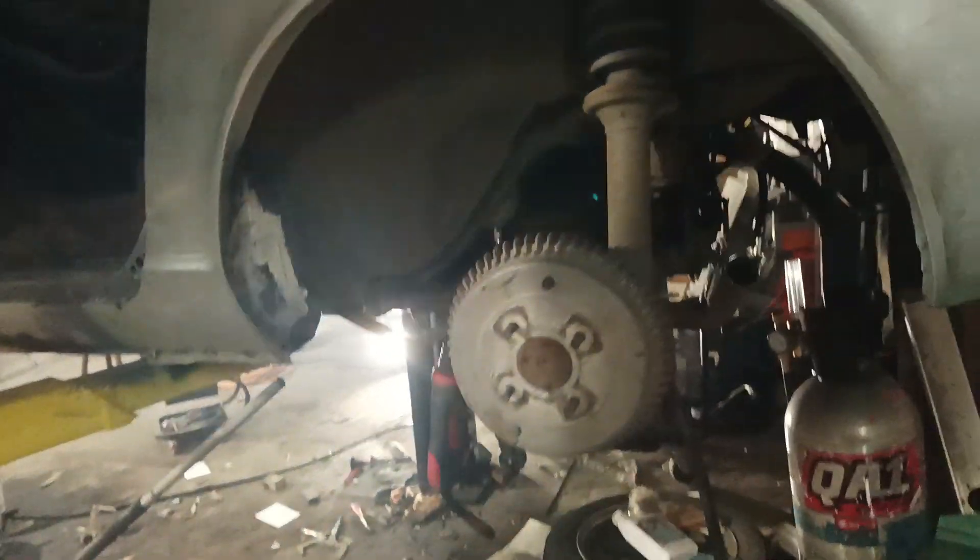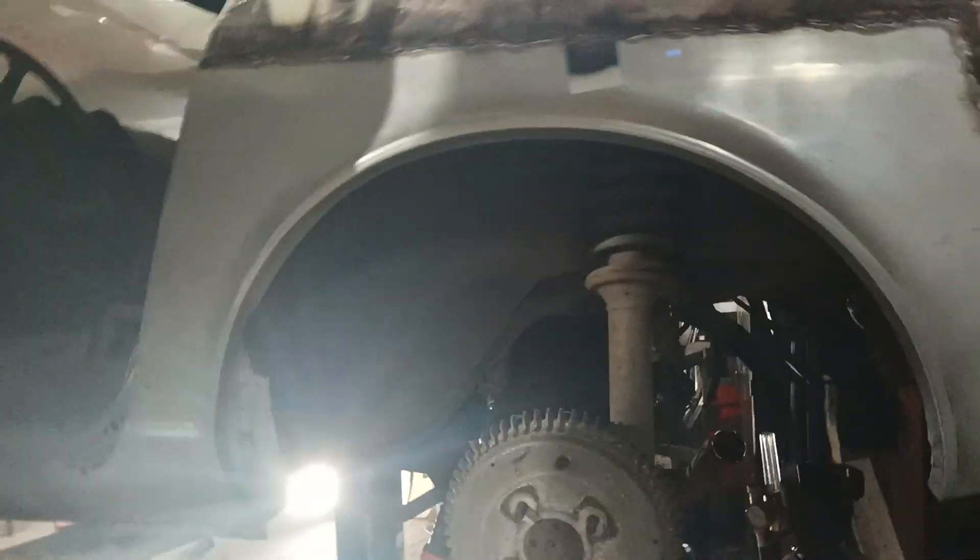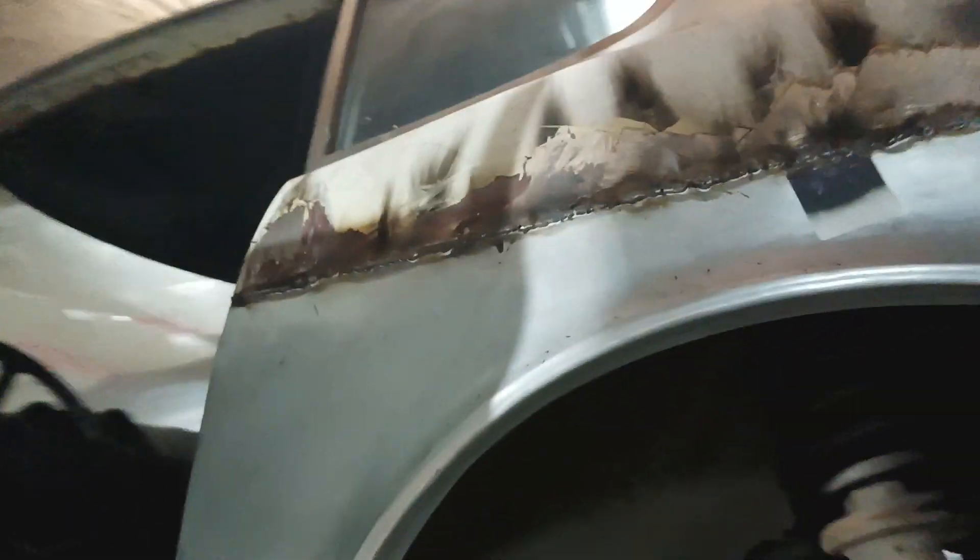It's not primo but we'll grind it down and it'll look a lot better. When welding these with bondo present, they have an inner lining of tar-type seam sealer that starts to melt and heat up into the weld. If you do any more than a couple millimeters of weld at a time it will start burning away and contaminating your weld.